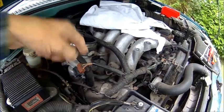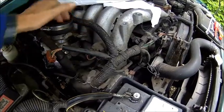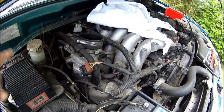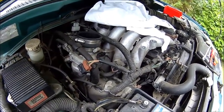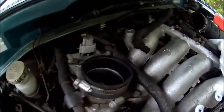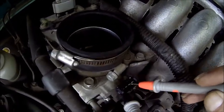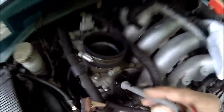Let's figure out where the connections are, and then if we move the throttle body we should see some movement. There's always two tracks for safety reasons - if one track doesn't work or has dropouts, we know what the problem is and we need a new sensor. They're usually somewhere between 5 and 20 kilo ohms. All we do is check resistance here. That's one kilo ohm. That's two kilo ohm. It's probably a two and a half kilo ohm sensor.